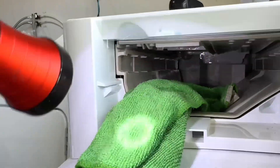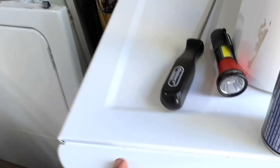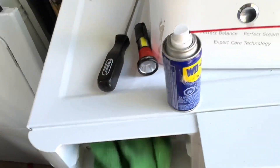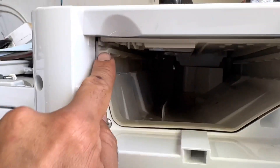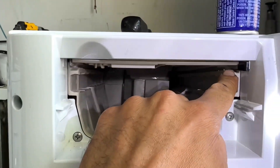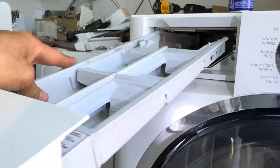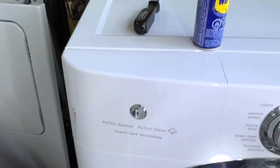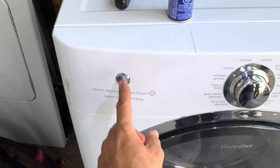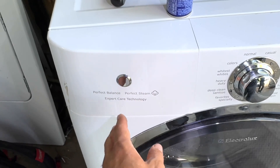You can pull out your towel. If you need to do some cleanup, do a thorough cleanup and then pull it out completely. Put your soap dispenser back in — there are two alignment spots, one on each side. You want to align the opening on the dispenser straight on both sides, left and right, and then push it back in. Once it's pushed back in, look at the difference — it's fixed! The more you use it after lubrication, the smoother it's going to get, and that will take care of the problem.